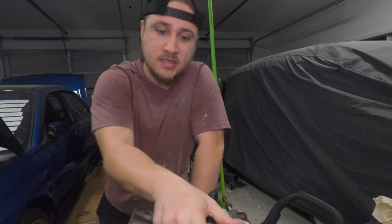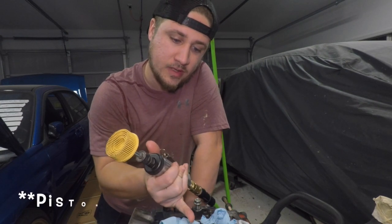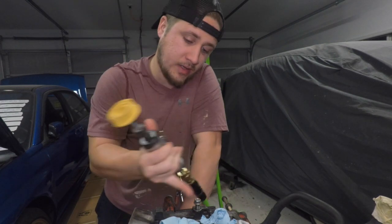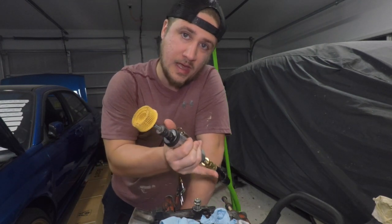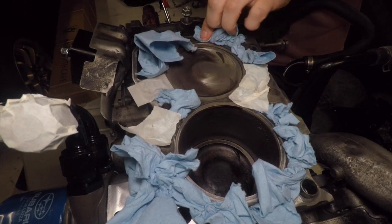Alright, so the last thing we have to do to get this engine ready to accept the new heads, which by the way you'll see in the next video, is I have this emery cloth that we are going to clean the heads off with. And then I also, now that I have the compressor in, can clean out the thread holes and everything like that. So let's get to it.